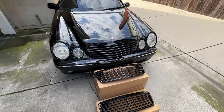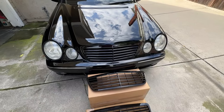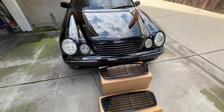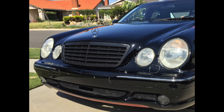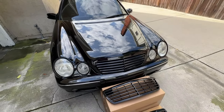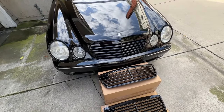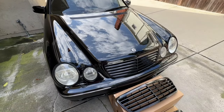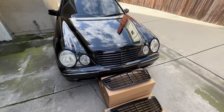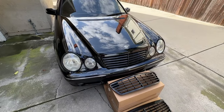If you don't really have a budget for painting your grille, there are a couple of alternatives. One that I did way back in the day was plasti-dipping my grille. I plasti-dipped it standard black and it didn't look too bad. I sprayed it initially with plain black, which looks a little dull and matte, not glossy. I added some glossifier, which of course won't look super glossy but it was better than before. I ran with that for probably about a year and it didn't look too bad. It still has the same chipping problems, but it's a little bit more durable honestly. It does not look as good as a proper paint job, which is why I removed it. The benefit of plasti-dip is that it's really cheap — I spent less than 40 bucks on everything — and it is easily removable if you do it right. So that's definitely a decent option for a lot of people.